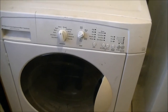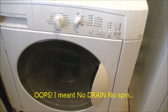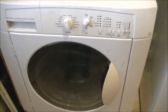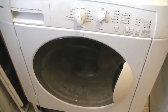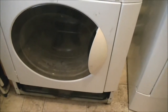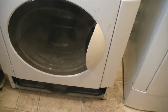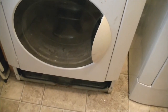But this time it was a little different. What happened was that the rinse and the spin were not working. I looked online to see how to fix that, and people said that the boot just before the pump sometimes gets full. So I decided to check that, and I'm going to show that to you.